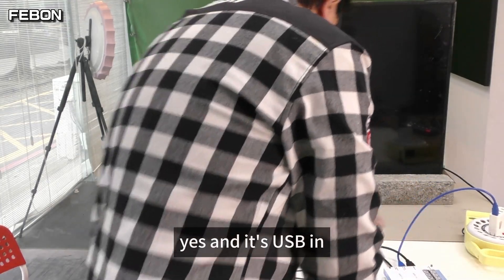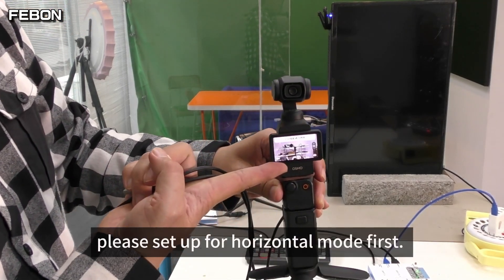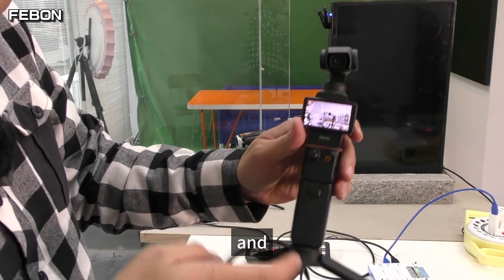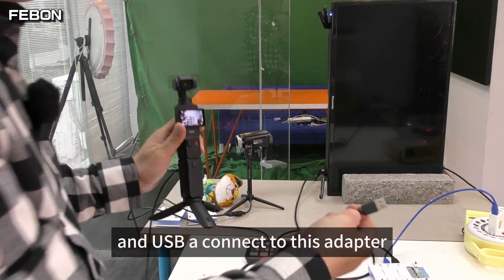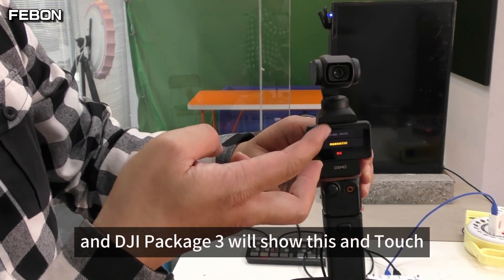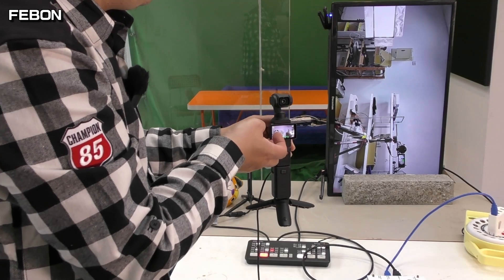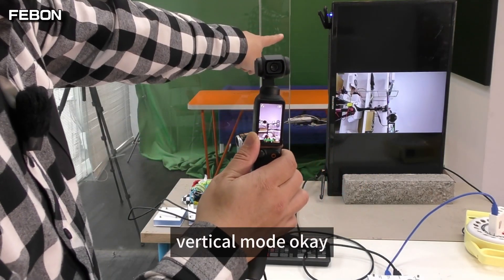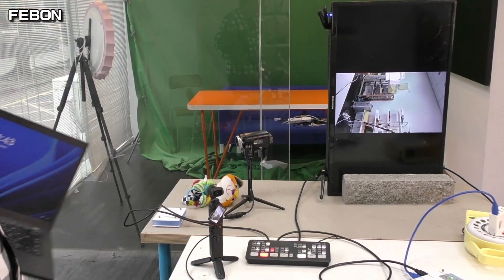Connect to the Antle Mini Pro via USB-IN. Connect with the DJI Pocket 3. Please set up horizontal mode first, because the adapter default is horizontal. Connect a USB-C cable with the DJI Pocket 3 here, and the USB-A connects to this adapter. The DJI Pocket 3 will show the USB webcam mode, and then it will display on the TV monitor. Then just switch the DJI Pocket 3 to vertical mode.